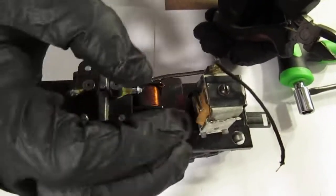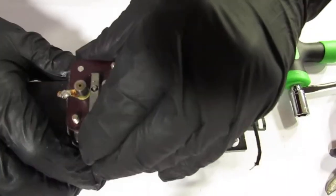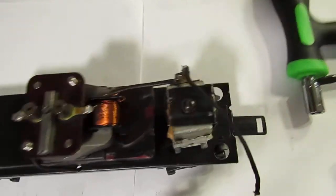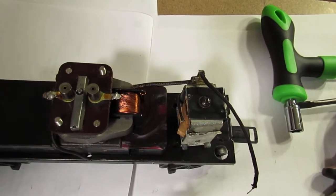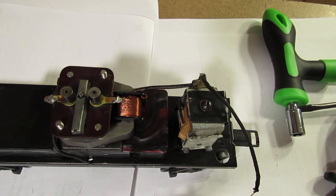Now when you put these back on, you have to sand a little bit or scotch-bright this, because they have a little bit of coating on them, and if you don't take that off it won't solder right. Being that I know we have to solder — as you can see, I never rehearse any of this stuff — so I'll get the soldering iron hot here. Give me a moment to get it plugged in. We always want to respect the soldering iron, because it can mess a lot of stuff up, and it also can burn the heck out of you too.